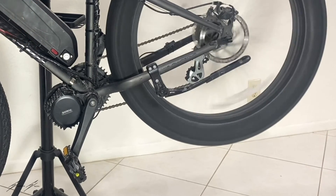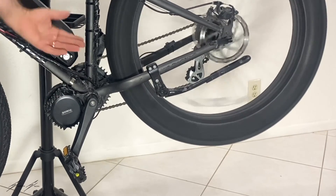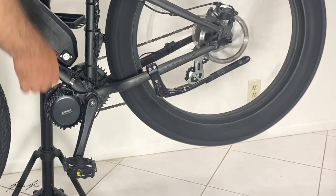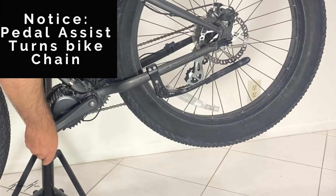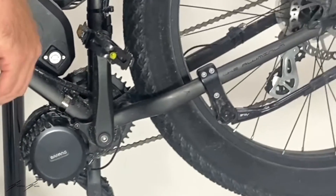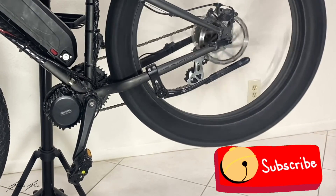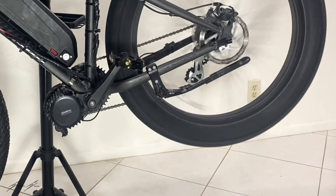I believe this is also a cadence sensor built into the motor here. The pedal assist is built into the motor — there's nothing attached anywhere externally; it's built in. And again, this is just level one. It sort of naturally picks it up after less than one spin, just like the other one, but it's much quicker. I would say about 25 percent of the pedal rotation is when the pedal assist kicks in, versus about 75 percent of the pedal rotation on the hub drive. It's kind of tough to tell exactly, but it's much more sensitive — probably 15 to 20 percent of a full rotation.